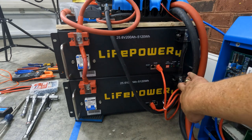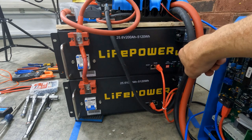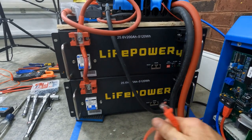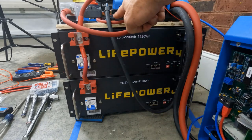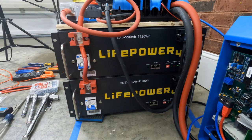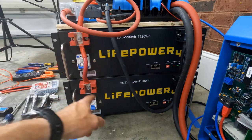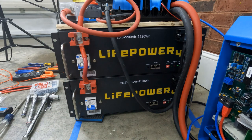From the negative terminal you'll see, in addition to the 2-gauge cable going between the two battery terminals, I have a cable coming from the negative up to the Victron Lynx and from the positive on the other battery — so I'm going from one battery on the positive and the other battery on the negative. Even though the two are connected in parallel, this allows power to flow in on one side, through the batteries, and out the other side. That's the recommended connection setup from Victron when connecting two batteries in parallel.